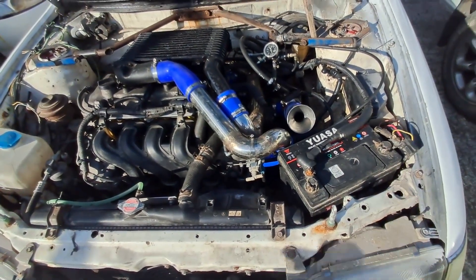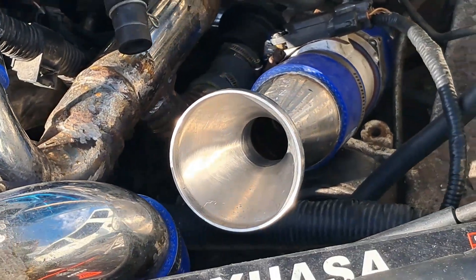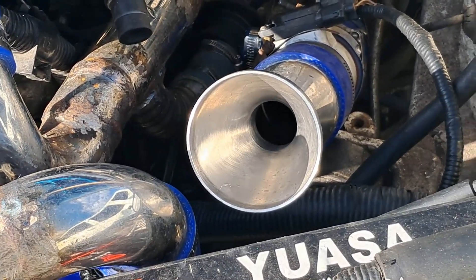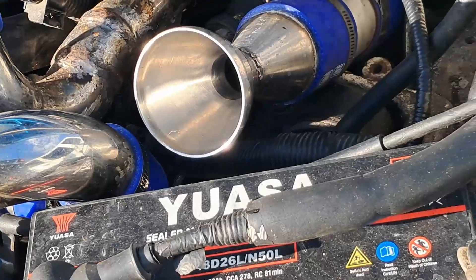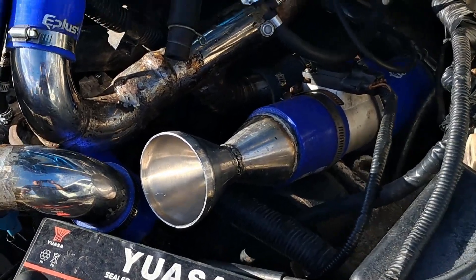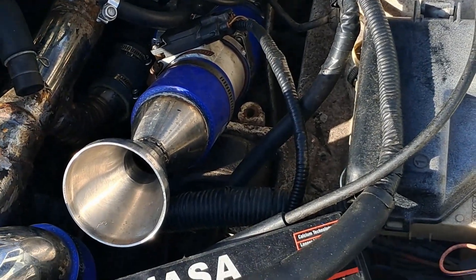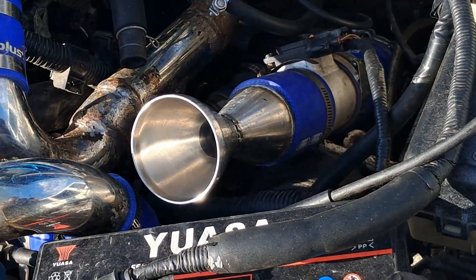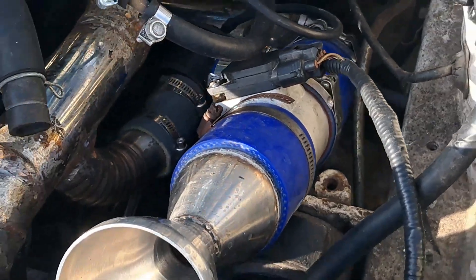With bends locally sourced nearby. Starting from the inlet — we are joining the 1NZ Cup later this month — this is what we came up with as far as the restrictor is concerned. This is a 30mm restriction for the intake system, as per rules, located in front of the mass airflow sensor. In this same spot we could also install a normal open-element mushroom filter for races where restriction isn't required, but for the 1NZ Cup, in the interest of parity, we have this trumpet of sorts. Stock airflow meter for the 1NZ with an aftermarket MAF adapter that we reused.